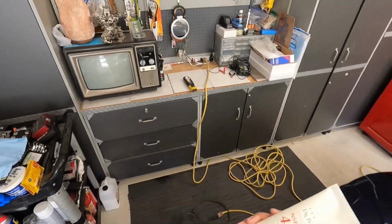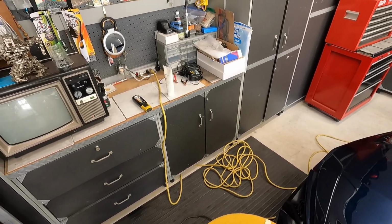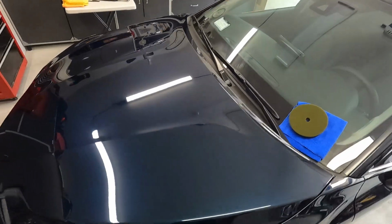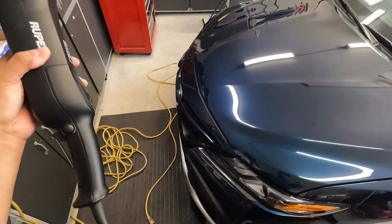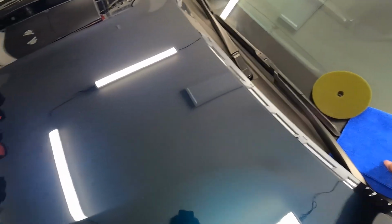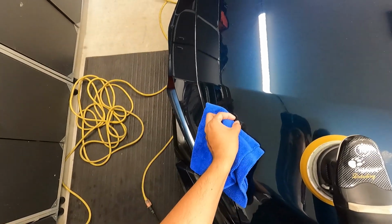And so with NSP 45, it's a little chunky. And when I prime it, I know Dr. Beasley says you only need like 1 drop, but I do 2, so I can actually spread it onto the pad here, just for priming. And then as you go around, you only need like a drop, they're telling you here. So I'm not going to put a tape line in here. I'm just gonna leave an imaginary tape line here. So this first, clean whatever that is on the paint here. That's a rock chip. I was wondering what that is.